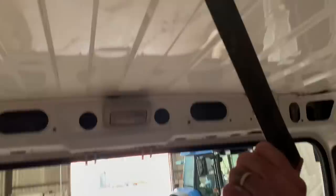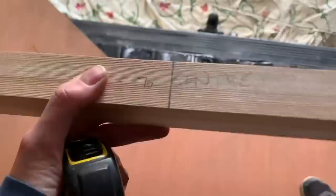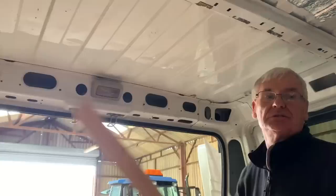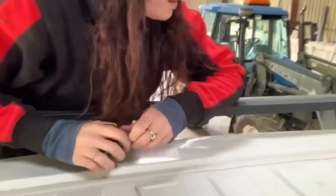We found the middle of the panel at 69cm, and this is how we're measuring it out — we mark 69 here again to find the center of the van, and then we can go either way from that center. Once we've got the van center we put the center of the template on the roof and that gives us the width so we can mark all four corners. We've got maybe 10 centimeters of clearance so not much room.